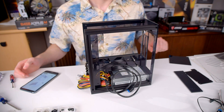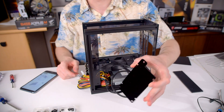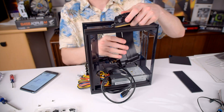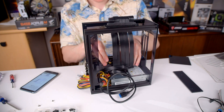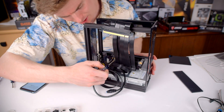And that's what it looks like installed. At this point you can install a 2.5 inch SSD that'll fit on the back side of the lower panel opposite the power supply, but I won't be installing any extra drive since I wanted to go for a cleaner look. After that, the PCIe riser cable gets mounted to the two shorter standoffs near the base. Bending it into an S shape first will make things easier when you're trying to fit the motherboard in. Two screws hold it in place and now you have a solid mounting spot for the graphics card.